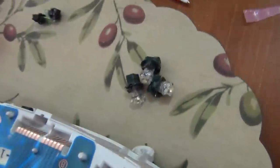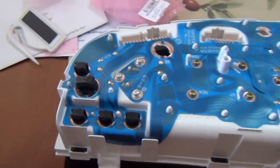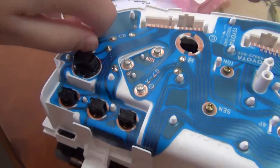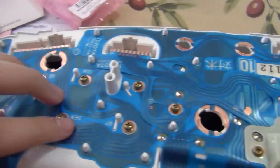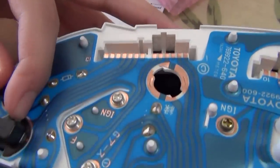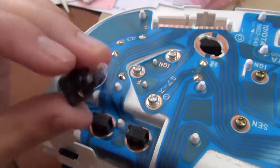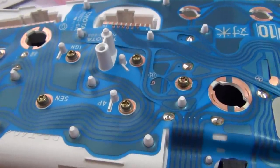Here's the back of the speedometer unit — we just took out the instrument cluster right here. You can see most of these bulbs have a printed flexible plastic circuit layout. These bulbs just come right off; it's a little circuit base. This is number 74 and the larger ones are number 194.